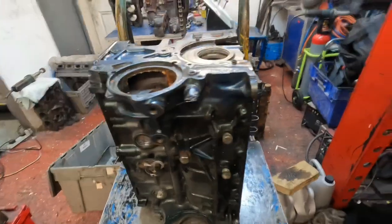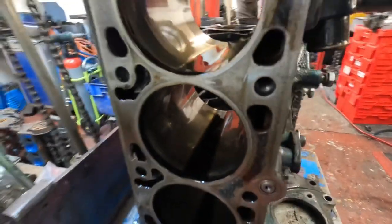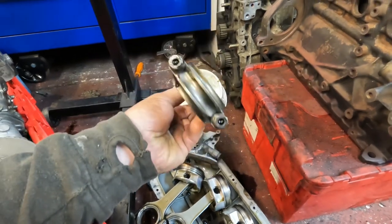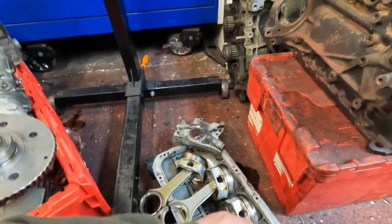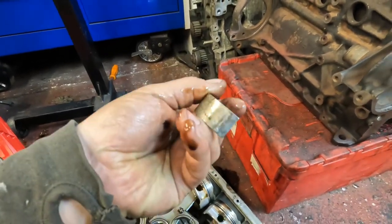The spare hot rod engine is completely stripped down, ready to go into the acid bath. The oil is in bad condition but the engine is actually in quite good condition. I haven't yet measured the bore and piston clearance, but for saying it's quite an old race engine, it's not actually so bad. We'll fit a new set of rings, new set of ARP bolts, new set of bearings, strip the oil pump, have a look at that, polish the crank, check the balance. The crank has been ground before to 0.25. We also noticed a water leak from the core plug.